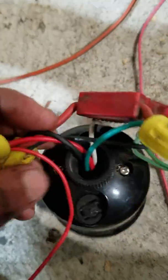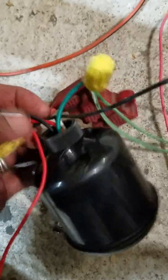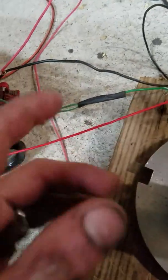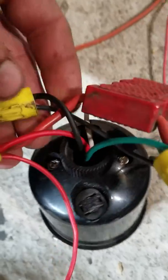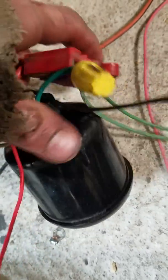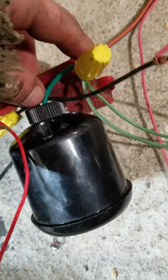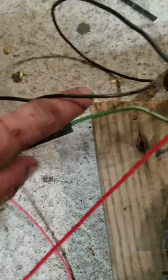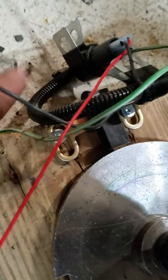That resistor acts as a pull-up so that when the signal sees a disruption it doesn't go to zero — it pulls up to 12 volts, and that allows us to actually work with this gas unit. The signal wire for the tach splices with that 1k ohm resistor and then goes directly into the sensor.